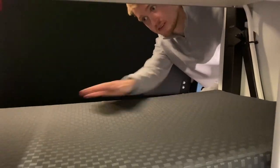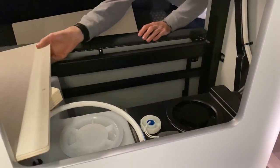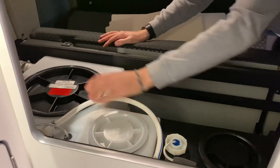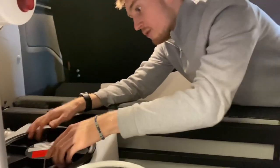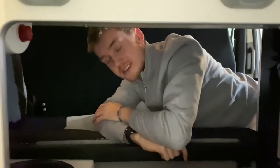Your gas and grey water supplies are both contained underneath this cushion. Remove the cushion and you're presented with two little plates. Once you remove these, you've got your bottles for your grey water and your fresh water, and once you unscrew this lid you've of course got your gas. There's also a control for your electricity just down here — twist this anti-clockwise to turn all the electricity off in the Nugget, and then turn it back on and the lights will start coming back on. You've also got your pump for your sink and a few fuses.